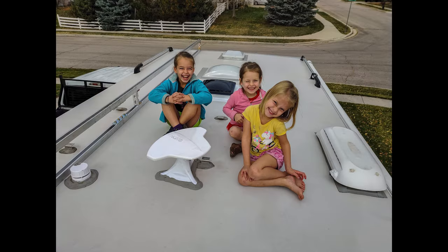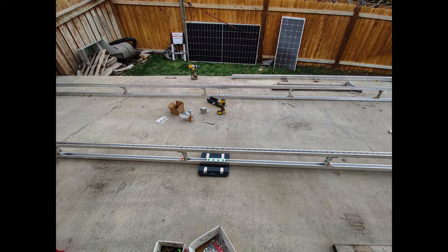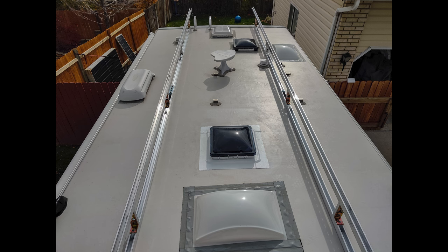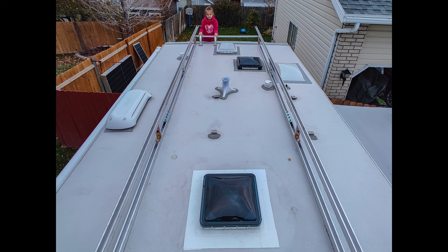As you can see, the racking barely fits straight down the length of the roof — but barely is good enough. I weighed the Unistrut channels and they came in at 34.6 pounds each side, so about 69 pounds total for the core racking components. There was also a little additional Unistrut added on top of that.